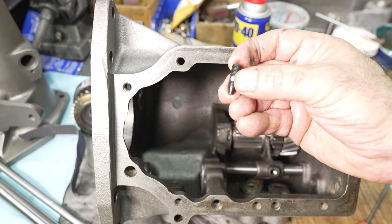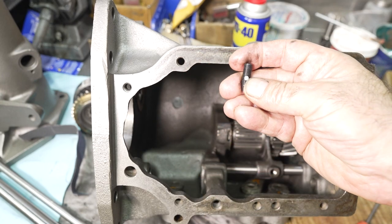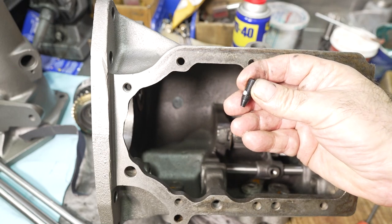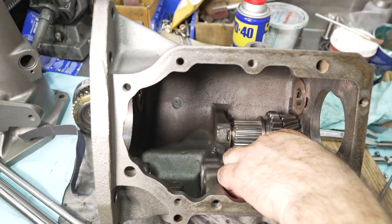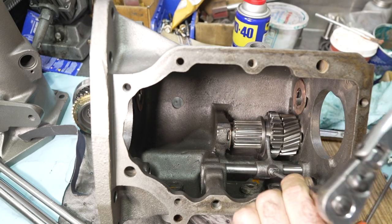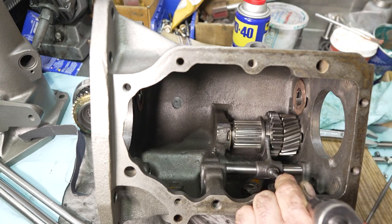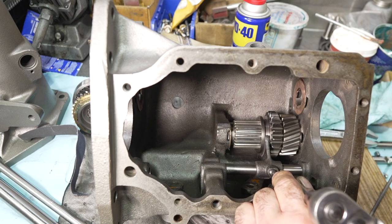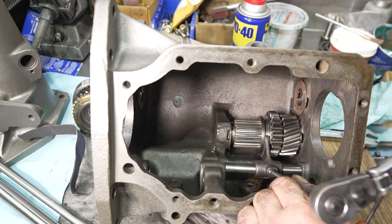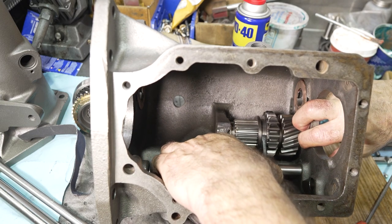By the way, if you can, use new set screws because they have a new nylon washer in them. There's really no torque spec for them, but just lock it down until you can't go anymore, all right? And it's a tapered pin, so it will self-center on a rail and then just tighten up. Perfect. If you want, you can actually check the action, see?